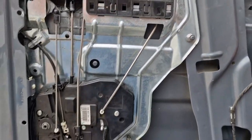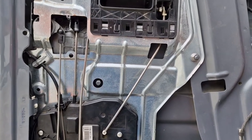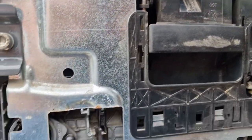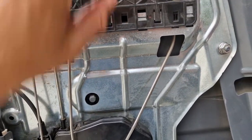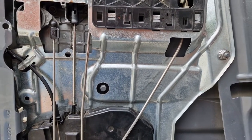The T5 has an issue with the barn door central locking mechanism. When you lock it with the pilot they won't open from the outside, of course, but when you unlock it with the pilot they still won't open from the outside — you have to pull the inner mechanism to get it working.